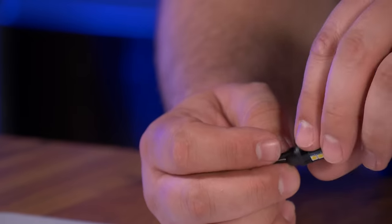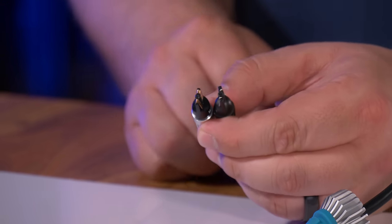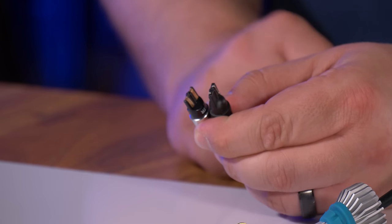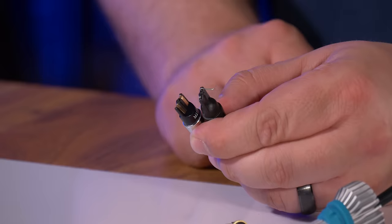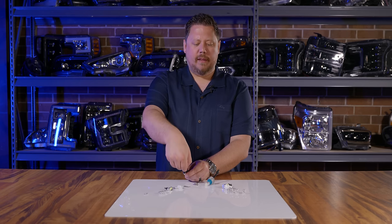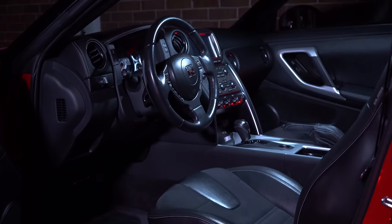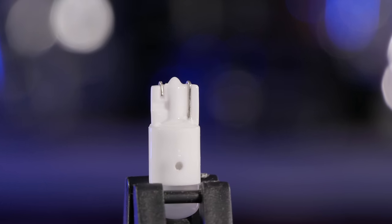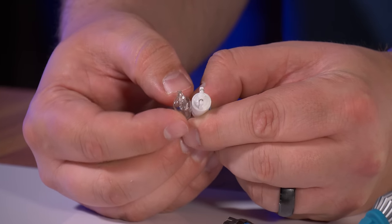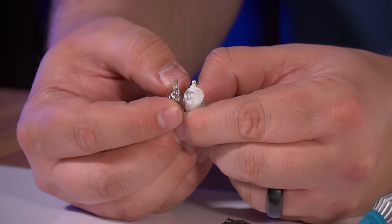Also look out for the type of connections on the back. I like the style that comes on GTR Lighting bulbs because they're wide and make really good contact with the socket. Thinner wire-style contacts are easy to bend and break, and can squeeze together so far they don't even make contact with your socket. The Xenon Depot XTR T10 has a similar wire connector style but with better design specifications that more closely match the original bulb — no issues with contact, pulling out, or breaking. The Xenon Depot XTR with the wire contacts is one of the best you can get.